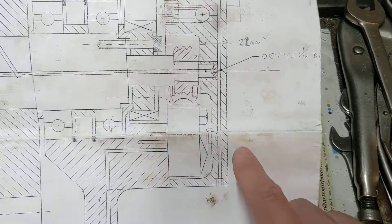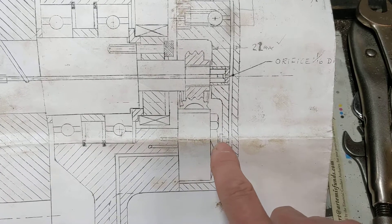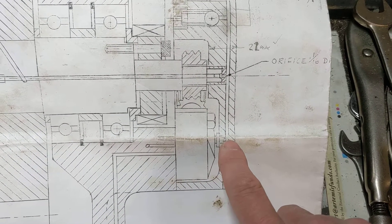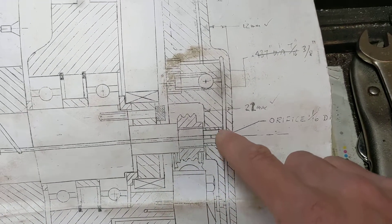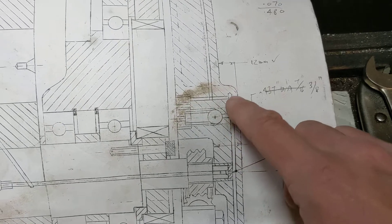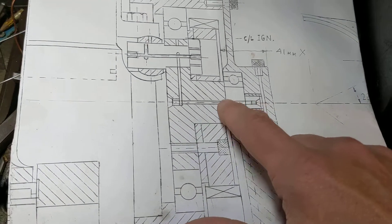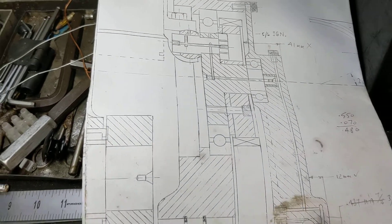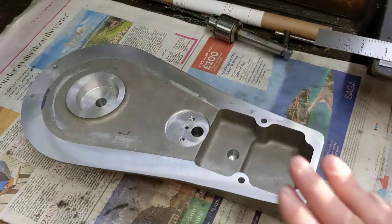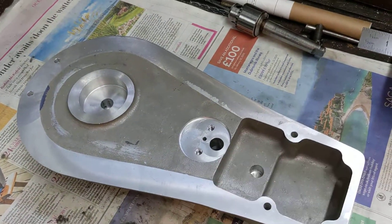So back on here — this is the oil pump looking sideways on — that's where the oil pump pushes the oil out through the nose and then up here into the big end for the crankshaft, up here past the oil pressure relief valve, do a little dog leg up here into the sleeve drive crank and to oil the plain bush that drives the sleeve. So that's one good piece of work that's been completed now and there will be more updates to follow.